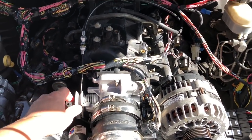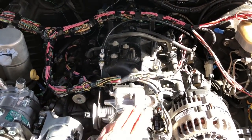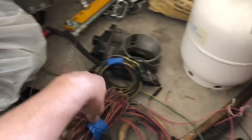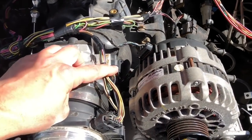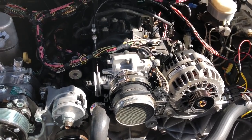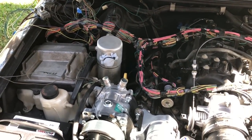I decided to go drive-by cable because I didn't have the throttle pedal, which you need for drive-by wire. That was a big nightmare. I had to remove a big bundle of wiring from the computer to go from drive-by wire to drive-by cable. Additionally, I had to add three sensors to the harness — removing those wires and adding new ones — and that's before even dealing with the starting system.